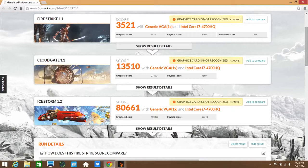The new NVIDIA GTX 860M has been improved for power efficiency while still matching the performance of last year's 770M Kepler series. If you're comparing the 860M to the 755M found in the Lenovo Y50 then the 860M blows the 755M out of the water. However, if you're comparing the 860M to the 755M SLI dual graphics setup, then the slight advantage goes to the 755M. But the downsides to the SLI dual graphics setup is it'll run much hotter, consume significantly more power, and be less compatible with many of today's games.